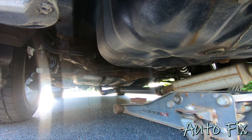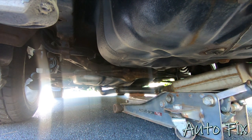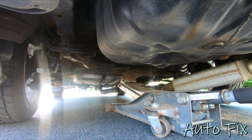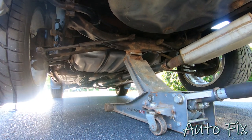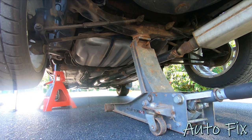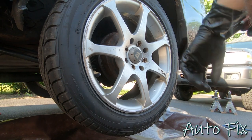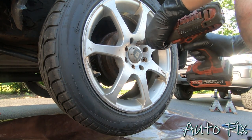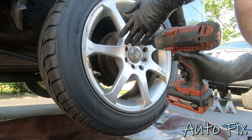There's a little nub on the center of the rear subframe — that's where you want to jack it up from in order to raise the rear evenly. Take the wheel off; usually it's a 21 millimeter socket. I have special lug nuts to fit this wheel so I'm using a different tool, but 21 millimeter socket if you have stock wheels.